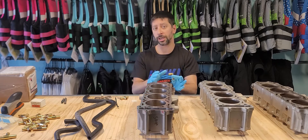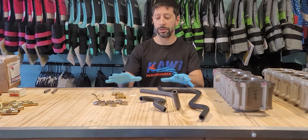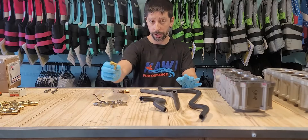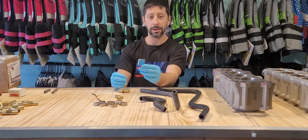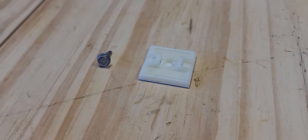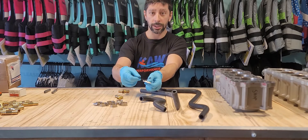So if you're upgrading to the 310 cylinder, this is going to be the kit you'll be purchasing. It's all the hoses you need, the T that you need, all the clamps, and the check valve. There's a screw here that goes on this mount to hold the hose away from the supercharger pulley — otherwise the supercharger pulley will chew through the hose and you will have a very serious problem on your hands. So that's the screw, the mount, and the zip tie for that.